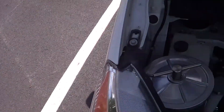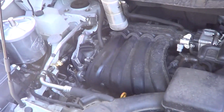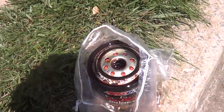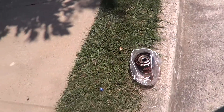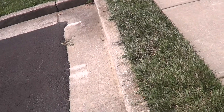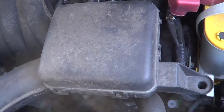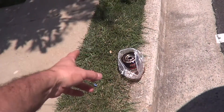I have an update on my bypass filtration on a gasoline engine for an NV200 van. It's a small four-cylinder engine. This is the AMSOIL pleated 2-micron bypass filter — part number EABP-90. I couldn't get any noticeable cleaning improvement running 10,000 miles, and my oil would still be pretty dark, which I think is normal. I did a bunch of particle count tests and couldn't find any difference having the bypass filter in-line or not.